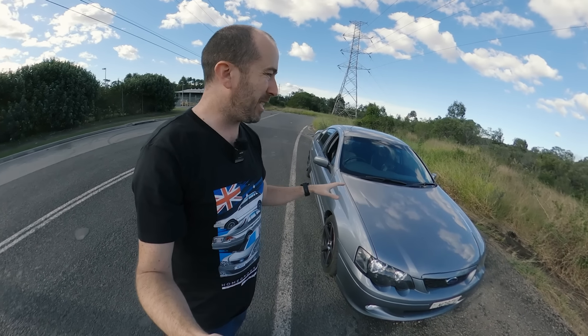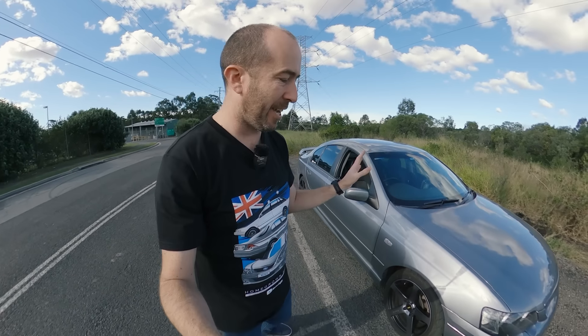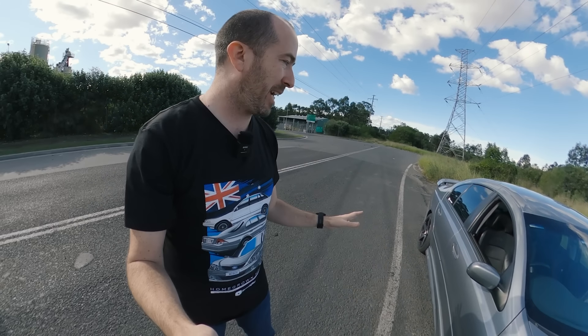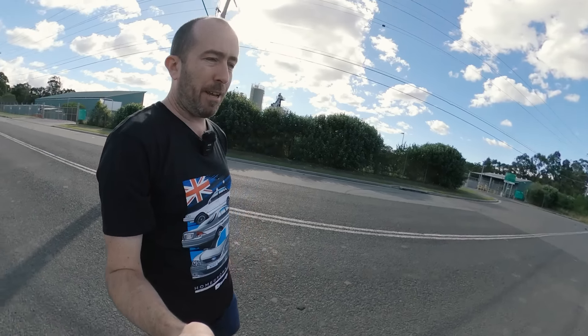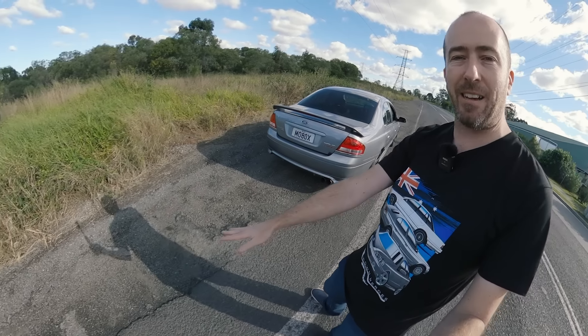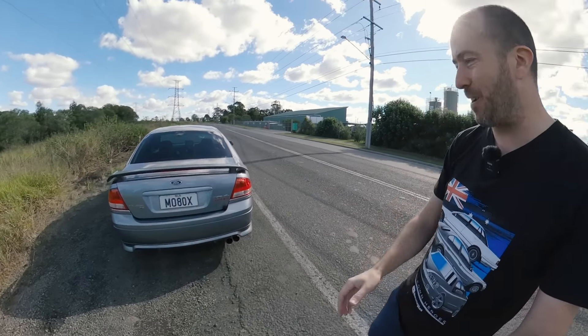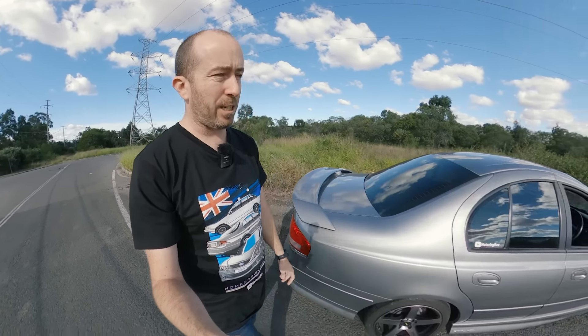But there's a lot that goes into driving a car — in particular, how it goes when you start at cold, how does the throttle respond at low speed cruising conditions, stop-start traffic, especially when it's cold. So I had huge issues starting this car initially. It was starting really rich, blowing black smoke. You would even see black splatter on the ground behind the car as it was idling from a cold start. So I got in touch with Hoff and he said we'll need to do a cold start tune.